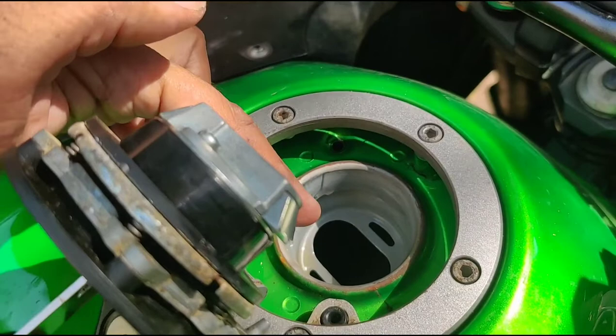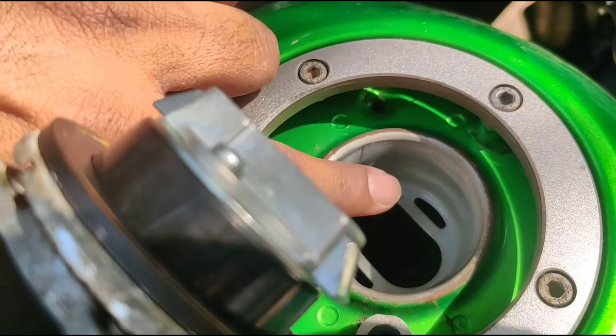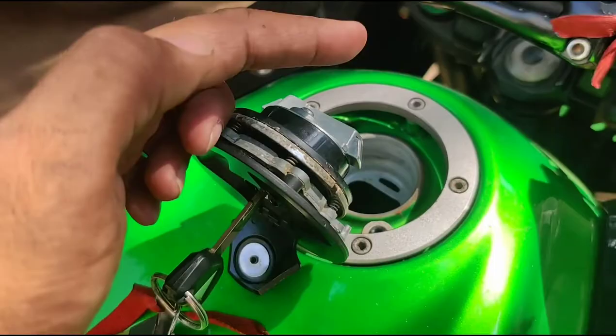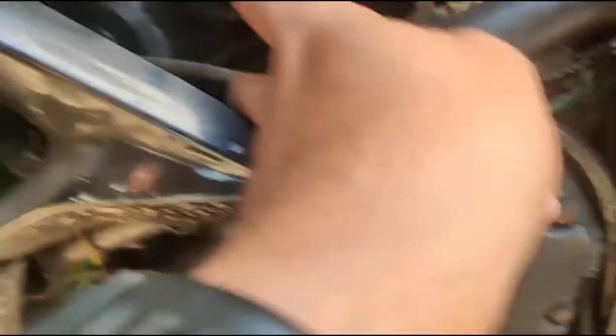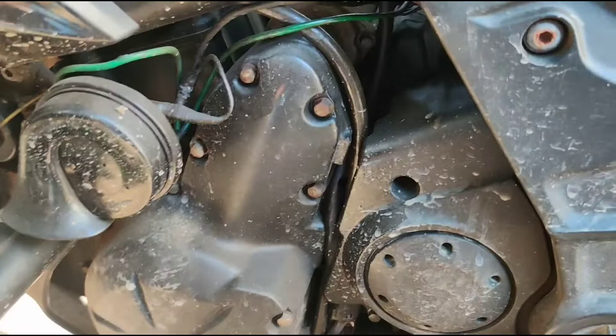A third case is overflow. Ideally you should fill up the fuel to the inner lip — don't fill it to the outer lip because it's going to overflow. When you have an overflow, the overflow goes down via this particular breather vent. There is a pipe connected here — depending upon the motorcycle design, the pipe from that breather vent goes down. In my case, this is the pipe which comes from the vent and goes down, so some overflow fuel goes down through it.